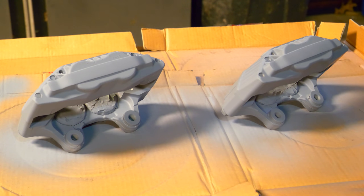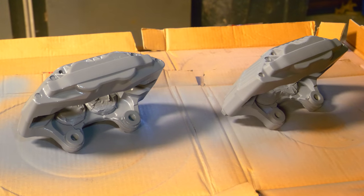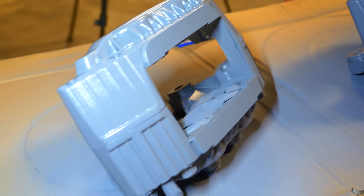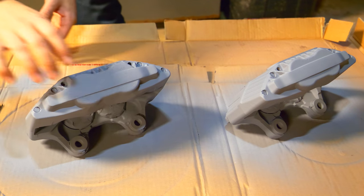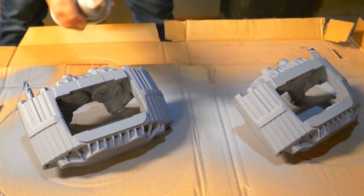Hit the caliper with a second coat of primer to make sure you get every square inch covered. After this coat, let it sit for a few more minutes because we're going to adjust the caliper, move it, and spray it down with primer again to get the really hard to reach areas. After the second coat it should be shiny again, but we want to let it sit a bit longer so we can hit the back parts we couldn't reach before. Once it's dry, tilt the caliper down to hit the backside, spray it with primer, let it dry, and then move on to our base coat.